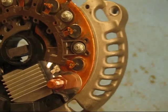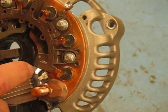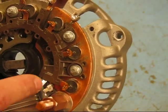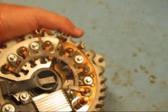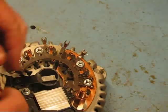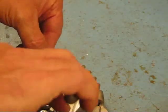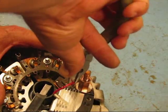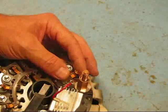On this unit, when doing this adaptation, the stator signal coming out of the rectifier does not quite line up with the one on the new adapter regulator. So what we're supplying with this is a little jumper wire, and this is going to be supplying the positive power to the unit. What we do is we first just plug that unit in here.